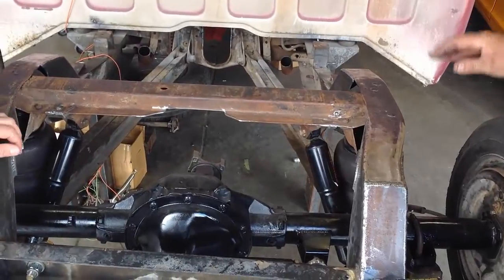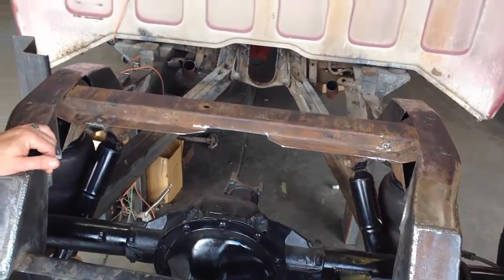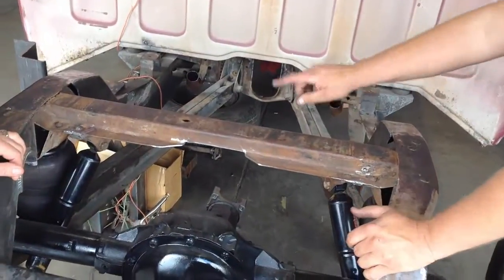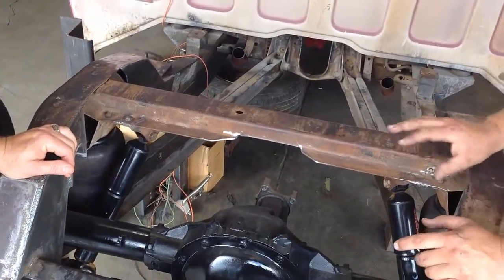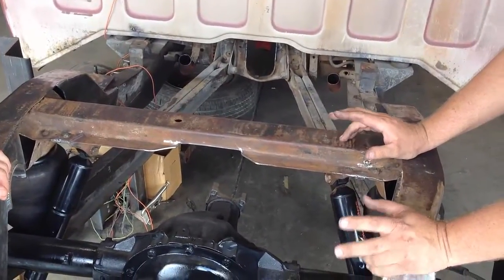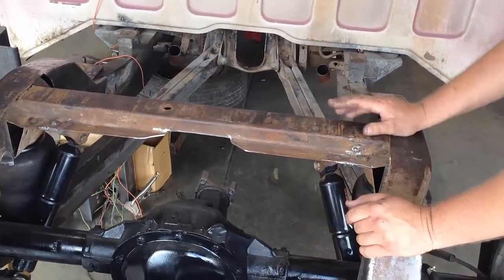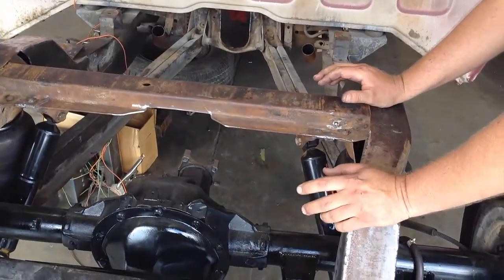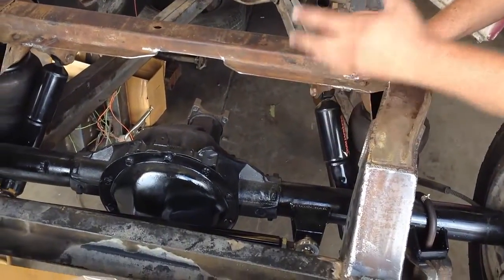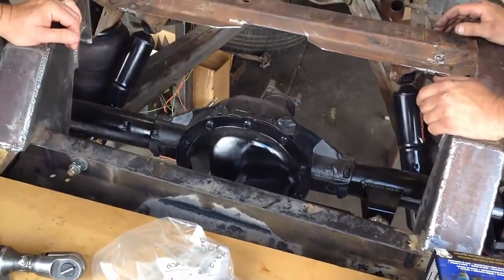And keeping driveline angles so that you don't get a shudder from takeoff is somewhat of a challenge, because the trailing arm style rear suspension induces pinion angle change that you may not have if you have a 4-bar suspension. And this is already a good suspension. It works real good going down the road, but because of the airbags, you can ride at multiple different ride heights. It's hard to set it up for one particular spot where the thing will ride smooth.